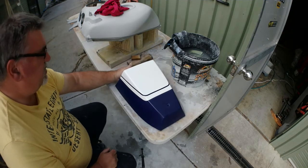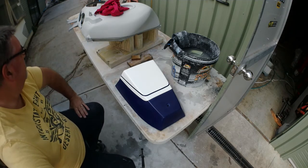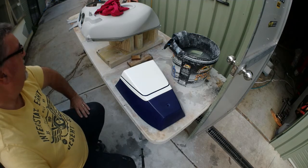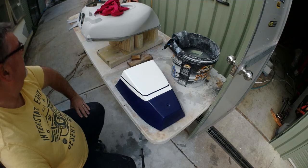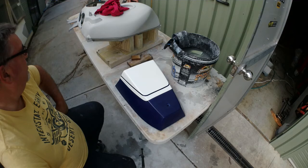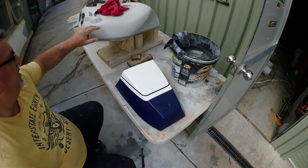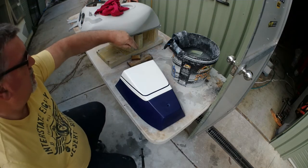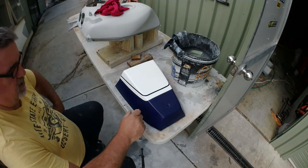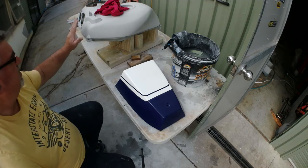I'm tossing up in the air with this one because it has blue on it, so I'm just not sure yet. I still think that I'm going to put white on it as well, and the white covers a lot better, and then once the white is on it, I can put the blue on it without any prep, so I'll mask it up and then put the blue on it. So I think I'm going to do it that way because of the white being a much better base. It covers a lot better. Where the blue, you've got to work it and work it and work it and put a lot of coats on. This probably got 8 or 10 coats of blue to cover that. So it's a lot of paint where you can do it a lot more efficiently.